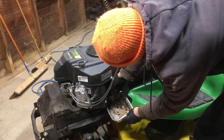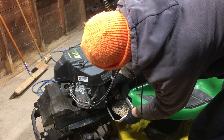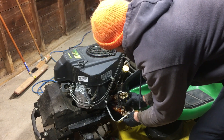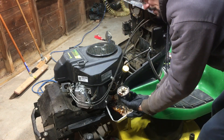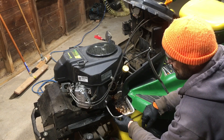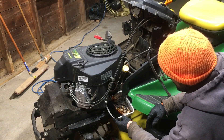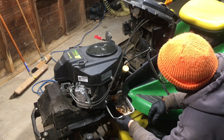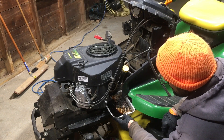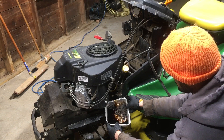It had it hand tight, so as we loosen this — there comes the oil. This whole filter is maybe a cup in size so we kind of drip that out, and then if I hold it like this I can get this over to my funnel in my waste jug, let that drain, making sure not to spill any out the side. Then I'll pull this out of the way, grab a rag, and wipe up the remaining drips on that little lip there.